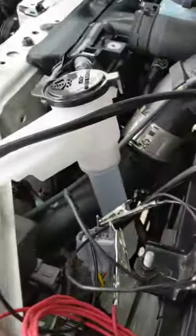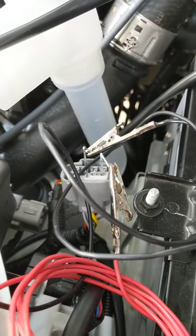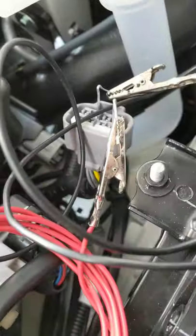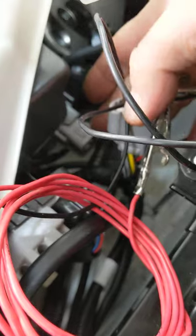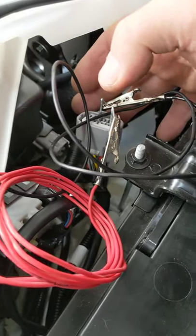What I've done is the old fashioned pin-out, just using split pins, found from the plug that goes onto the back of the headlight down here. In front of the battery on the left hand side, because you're going to be running your wires through along the main loom.